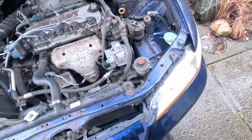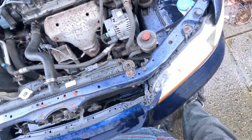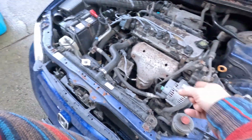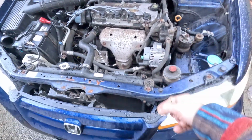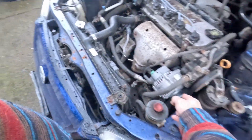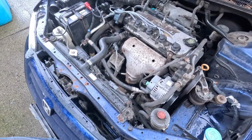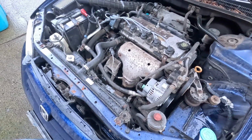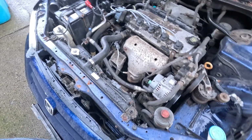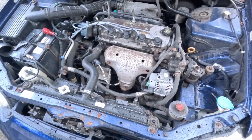When I first got it repaired after being around for 2 years, it seized up. It was smoking, and I realized that it had been sitting so long that the alternator had frozen up and seized, so the belt was slipping over the alternator and smoking. So I bought a new alternator. So to get this thing running after sitting for 2 years, it was under $500. It cost me more time than anything, and that's because I'm pretty bad about that.